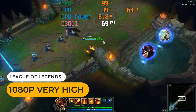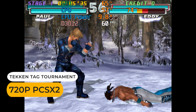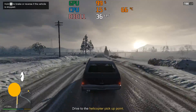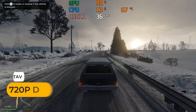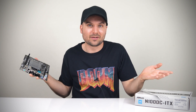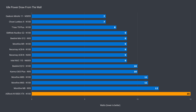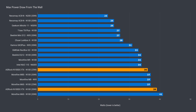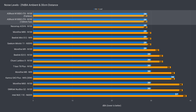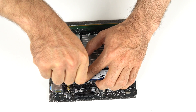If you wanted to play some games on it, the Intel N100 can handle some esports titles and emulation up to GameCube/PS2 era at 720p. You can even play GTA 5 at 720p and get a playable frame rate, but I don't see this board being used for that. It's more for a home server or media streaming setup, but for those usage cases, it doesn't really have a large number of storage options or even 2.5 Gigabit LAN. Idle power draw was unimpressive at 15W. Maximum power draw peaks at 39W with the increased power limit. The build was silent without a fan, but was still quiet with one.